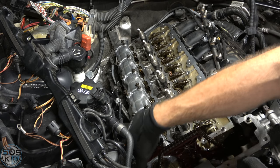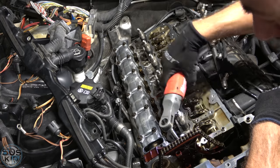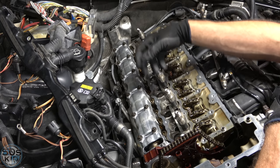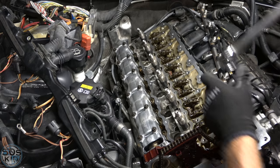I'm starting to suspect that the whole cracked camshaft thing on the forums is a little bit of a tale that just gets repeated — a friend of a friend's dad's brother's uncle once had a camshaft break in half. For the intake cam, check the cam lobe positions — it's cylinders three and six on this one that are about to come down, so those are the ones to watch out for. Double check that none of the lifters shifted when placing the cam.